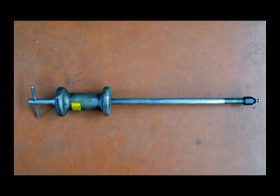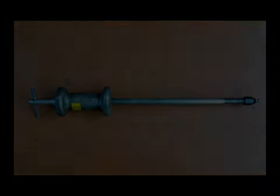If you drill out the EGR passageway plugs, thread them, screw a small stud in it, and then use a socket over that with a washer and a nut, you may be able to draw that plug up into that socket, if you follow what I'm saying. That's the only other way I know that you might be able to do this without a slide hammer. I have the smaller version of a slide hammer that I used to remove carburetor plugs, but it was just too light to do the kind of job that this is going to require.